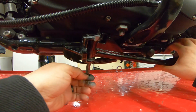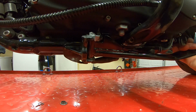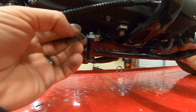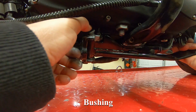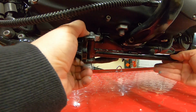And then you're going to shove the pin in all the way through, and you're gonna have anti-seize squeeze out. Make sure you have a rag off to the side. This stuff is nasty. All right, now that we got that cleaned up, we're going to put the other pin in with the groove facing down. Get it all lined up. Push the pin all the way through so it's nice and flush.